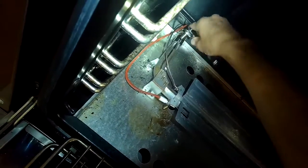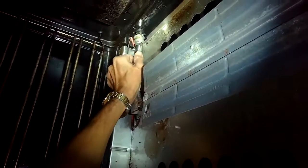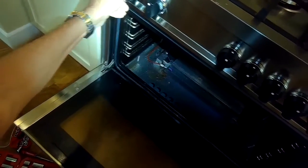This is going to introduce more fuel to where the ignition happens, making you more likely to get a positive ignition and start of your oven. You just have to check that you don't have too much yellow flame — you want a nice blue flame. If it gets yellowish, reverse the process and pull the sleeve toward you. So we dial this in through trial and error. Just started it up — flame looks good, nice and blue. A little bit of yellow tinge is okay, just don't want a lot of yellow. That seems to have helped — it gave us a nice fast ignition.